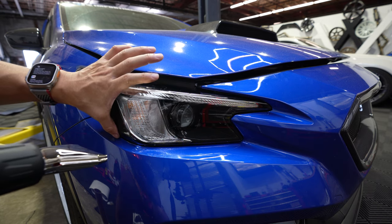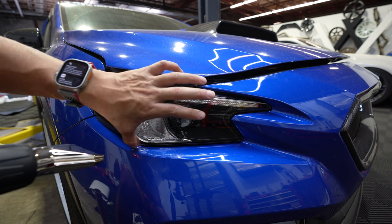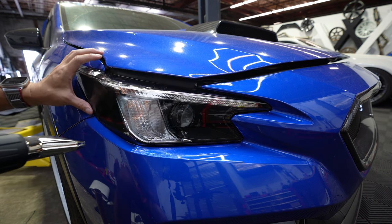I got close to the end and started swiping because I know I can stretch this over the front of the lens. Now that this is drying out a little bit, I'm going to go back with the squeegee and push the bottom part. I do want the vinyl to wrap around the bottom edge of the lens — when you get it to do that, there's less chance that it will grab during a car wash or when you're using some sort of high-pressure wash in this area.